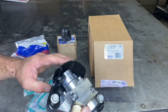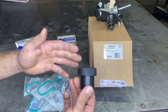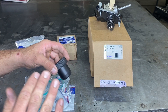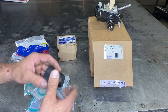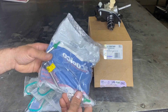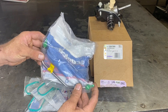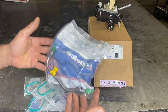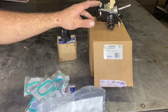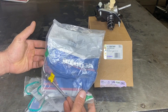Of course we're going to need a brand new fuel pump — I recommend going OEM with AC Delco. If you do, you get two new bolts, a new gasket, and a new bracket. We're also going to need eight intake manifold gaskets. This installation guide ensures the camshaft is at the base fuel lobe — it makes the job go much quicker. We'll also need a brand new intermediate fuel pipe, as it has crushed-style connections that do not reseal well once installed. I recommend replacing this pipe along with the fuel pump.